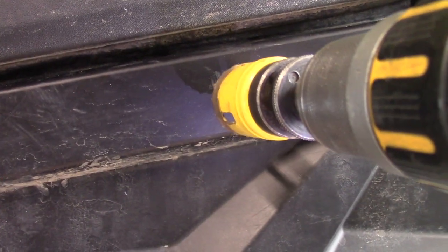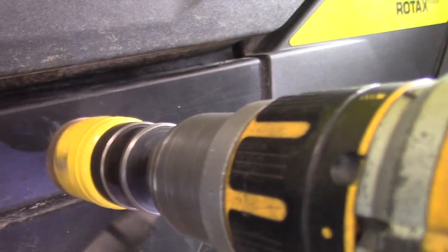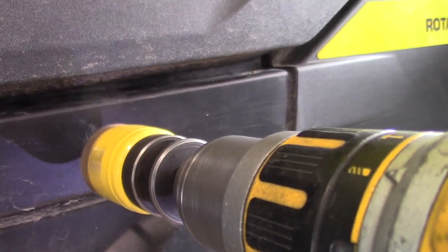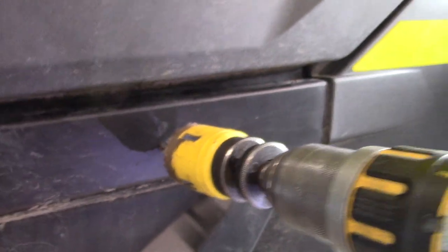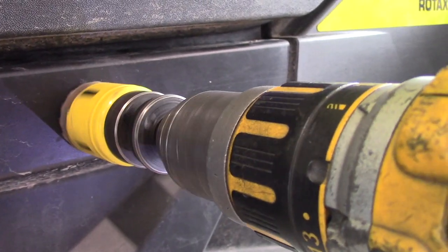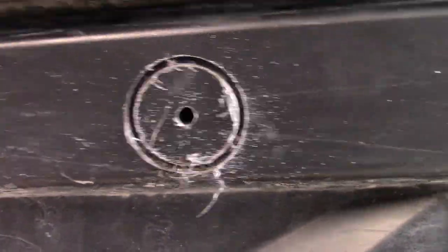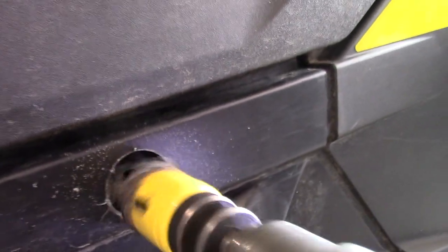What I'm going to do here is hole saw out these three points, because we can reach the backs of all three. Then set the bolts through, feed them through, and get them into those receiving washers and cinch them up. I think I'm going to have to chisel a hair off of the flare there — we'll mark that out, bump that out, and then mount them and cinch them up tight. I'll start drilling these pivot holes. It's inch and five-eighths — I know when you stay with inch and five-eighths instead of going to inch and three-quarter, because they always ream out a little bit. Always go slow on plastic so you get nice clean edges — if you go too fast, the plastic will grab and rip the drill and fork it, making an ugly mess.